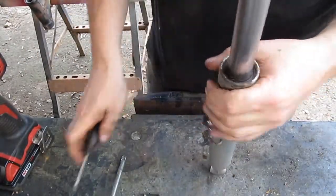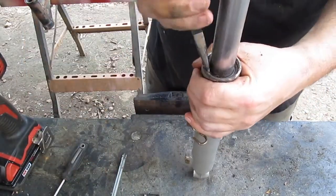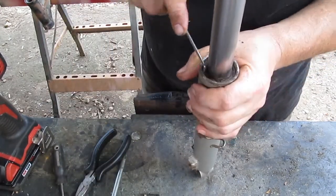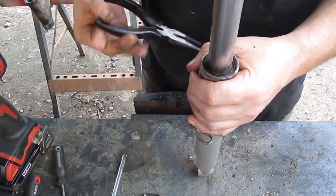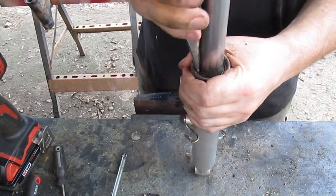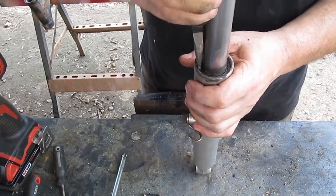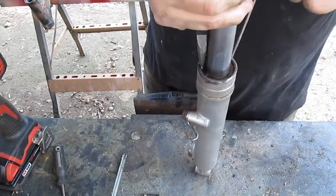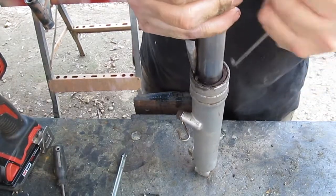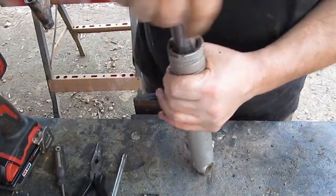I got that screw out. Now I'm going to clean out the top of the tube here and get a hold of the snap ring that's in there. I use a pair of needle nose pliers that I've filed out the ends of a little bit to make them get in the holes a little better. I've got to work and get a hold of them and try to get a pick underneath the other side and prop them up. I did finally get a hold of it — and there it goes.